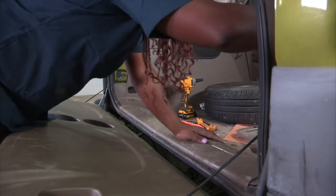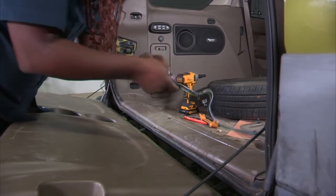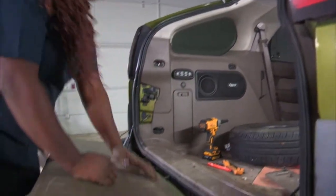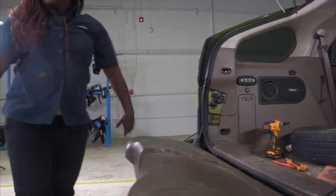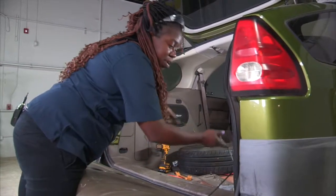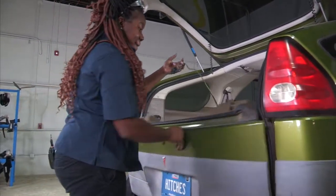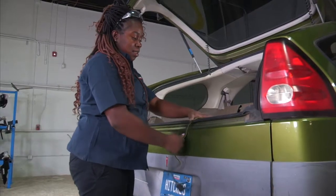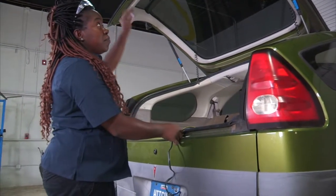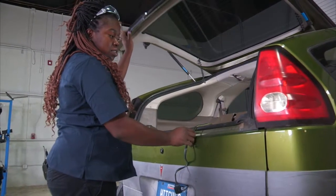There you have it — your wiring. Make sure you test it so it's working properly. Now that your wiring is installed, you will bring your wiring out. Close the trunk of the vehicle. Hang over the door sill and close down. Be sure to be free of the latch when closing.